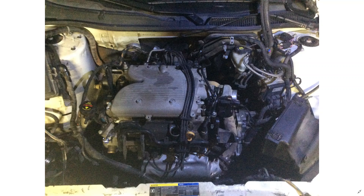Here's the entirety of the engine bay with engine and transmission all together — obviously some things have been removed. The power steering pump ended up over here because I didn't want to disconnect the power steering lines other than the return line. I disconnected that and just pushed it off to the side. We took off the air system, the air tube and whatnot — basically removing as little as possible, just what's necessary to pull the engine entirely so we can replace all the gaskets and seals.